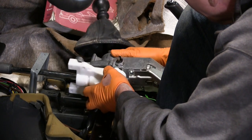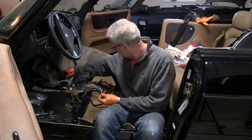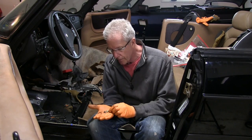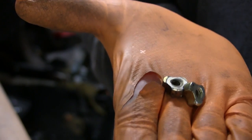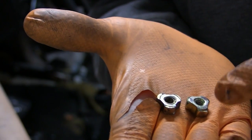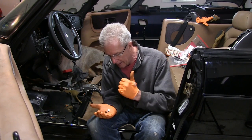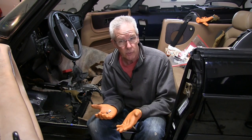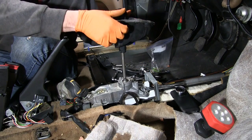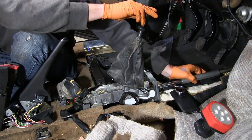After all we've just been through with the brake pedal, this was really pretty easy reassembly. The shift assembly is now attached to the shift linkage and it's ready to be bolted back in place. Saab installed that assembly with these odd little three-sided nuts — I assume that was a security precaution. I ground down an 11 millimeter socket to create fingers to get around these nuts to get them out, but I'm going to replace them and just use regular hex nuts going back together. The shifter is now in place and my Saab is closer to going back on the road as a five-speed.